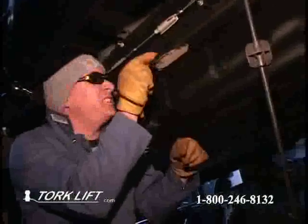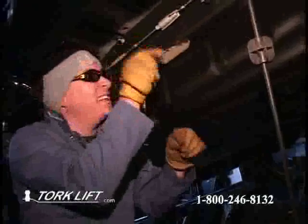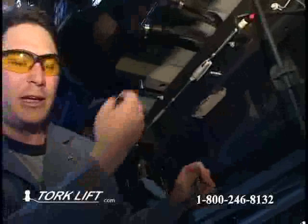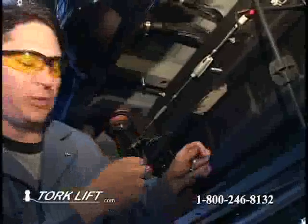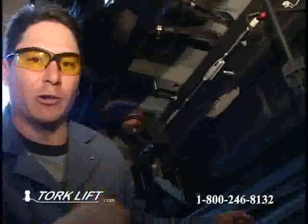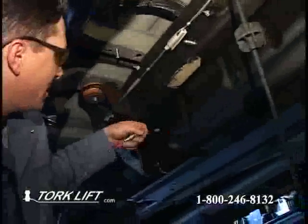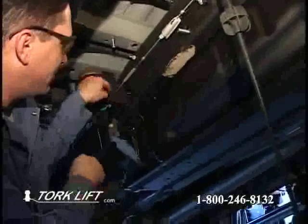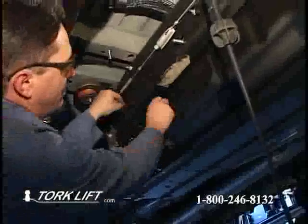Easy, man. You just use this bolt fisher they give you in the kit. Okay, the first thing you want to do is take your bolt fisher out of your kit and bend a hook in the end. That way, if you lose your bolt in the frame, you're not trying to fish your bolt fisher out also. Then what you want to do is run your bolt fisher through the hole that you need and down through the bottom of the frame.